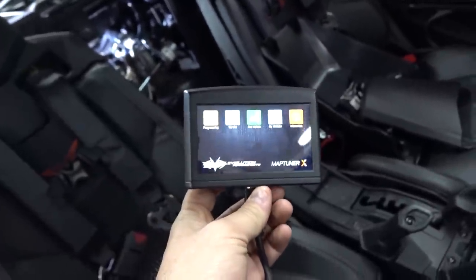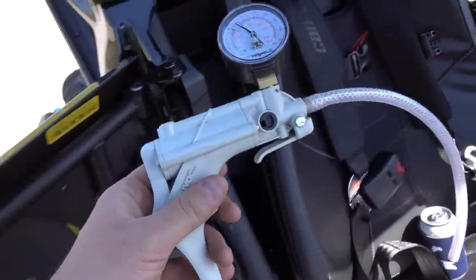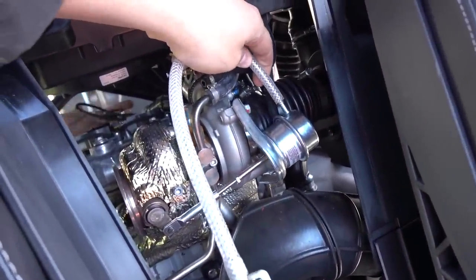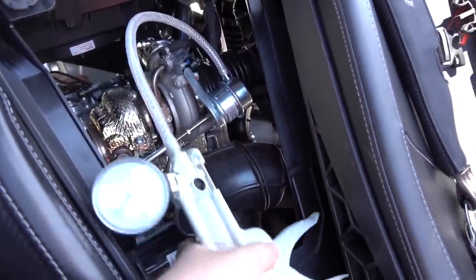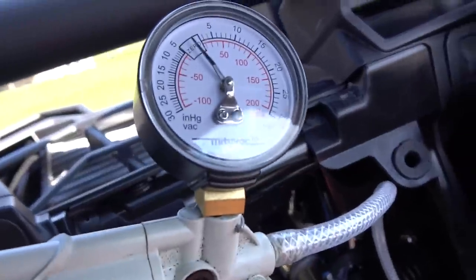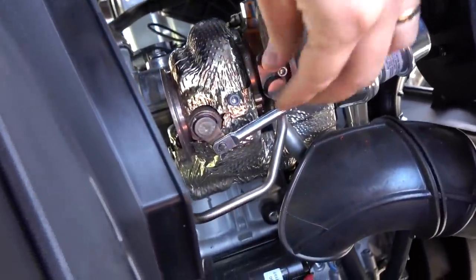Last thing is the new wastegate actuator — make sure the crack pressure is adjusted to 8 pounds. Mighty Vac time! We're going to use this tool to adjust the wastegate crack pressure. On the 3RWI kit it comes with a different wastegate actuator, and this tool lets us set the pressure at which the wastegate actuator moves and opens the wastegate to start bleeding off boost. I'm going to watch the rod and reference the gauge right when the rod starts to move — the rod just moved and we're pretty low, so we have to go in and tighten up the tension.